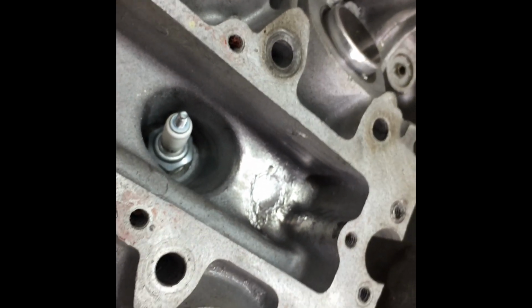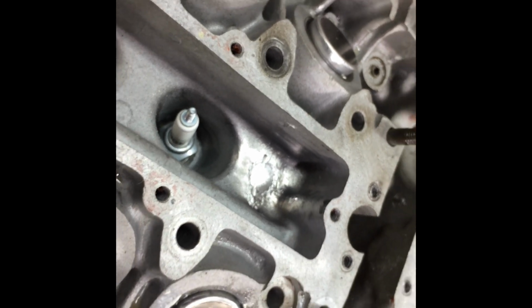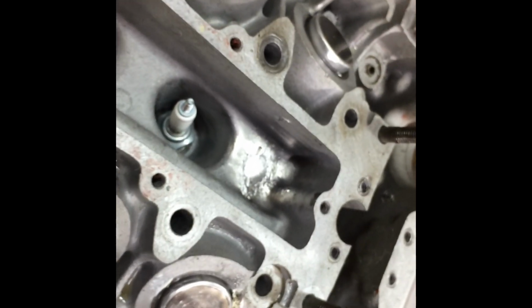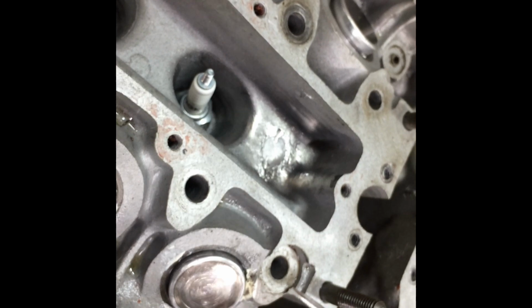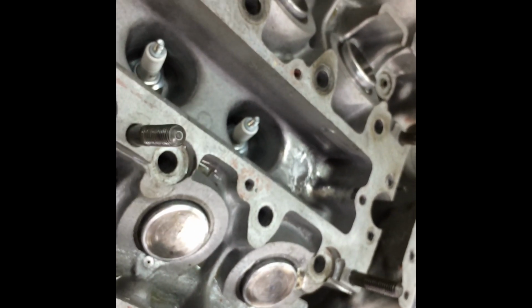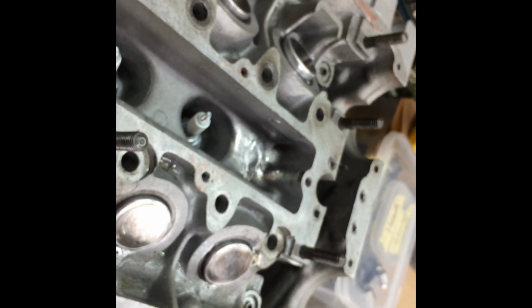I had another look at that stuff. I think it is some sort of an epoxy. So, yeah, I'm going to have to get the right petrol radiator cap too, because it's only a 5 psi system, this cooling system. And apparently you don't put anything higher than that on it, because it'll blow out and wreck the engine quicker. So we don't want that. I want to get the correct PSI cap for this, only 5 PSI.